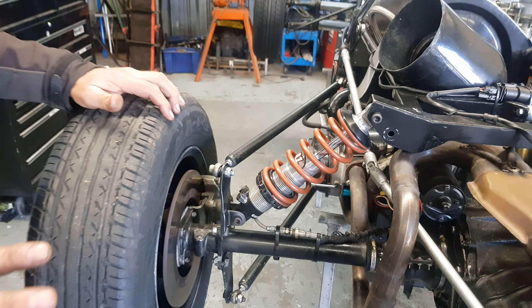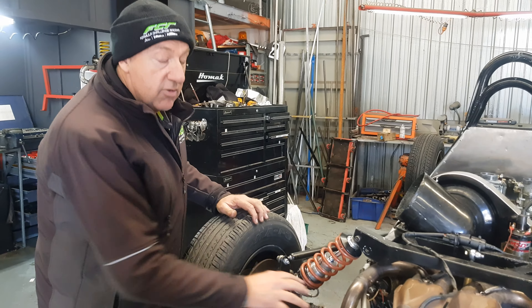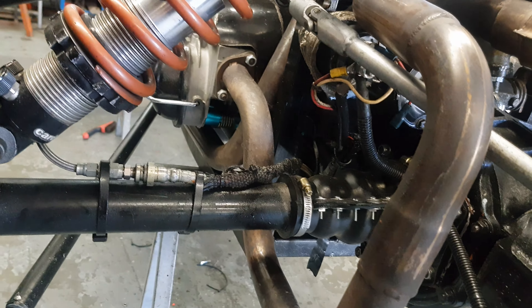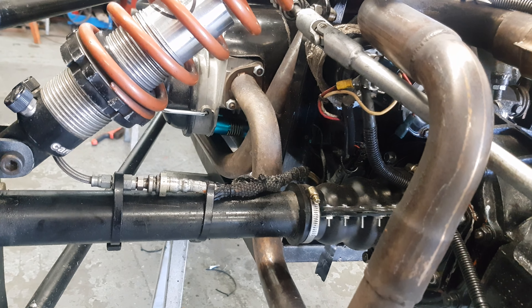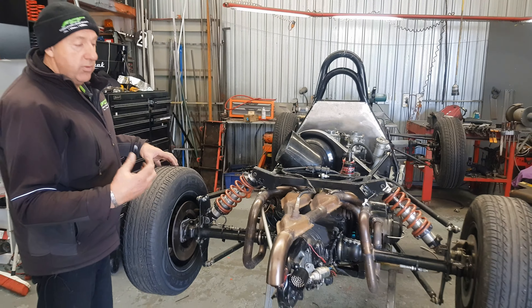Also make sure — which is common — that a lot of your leads, power leads, brake lines and everything else aren't too close to the exhaust. We've got one here that to me is a bit close, don't like that, and one on the other side too, so we'll just change that a little bit. Just keep it away from the exhaust — it does get hot, and the last thing you want is something burns through and you run out of brakes.